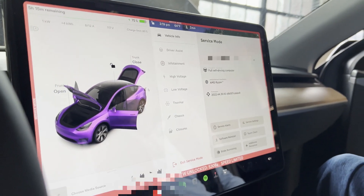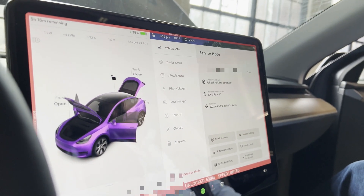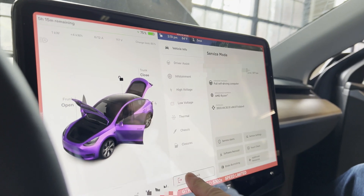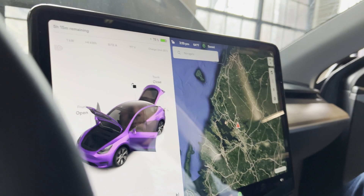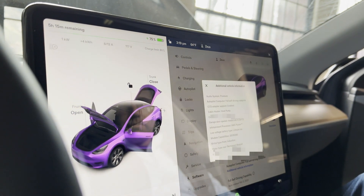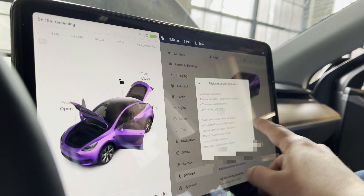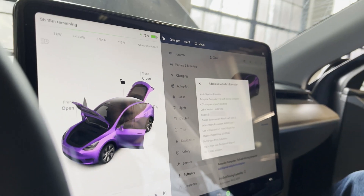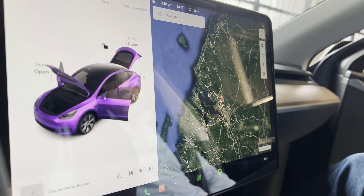We're back up after the MCU rebooted. Our gateway is still unlocked, but we'll go ahead and exit service mode. Once we've exited, go back to the software tab, click on additional vehicle information, and you'll see right here: garage door opener Homelink 5 is installed. So now we've got Homelink and we should be able to program it and get it set up.